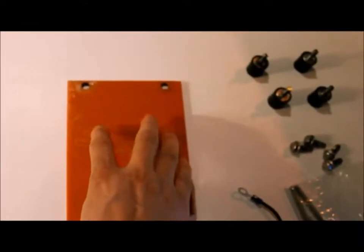Now, I could have not been doing the installation right. He gave a bunch of extra stuff but no instructions for how to put this in. I don't know if the plastic is hindering the ground — it probably would. He did provide a ground wire, and at first I thought that was a bonus. But I tried three different configurations similar to the original, and no matter what I did with that spacer in there, it kept throwing that code and not starting the car. I took it all out, put it back together, and it went back to normal. Maybe the plastic is why he gave you the extra ground wire — to reroute it.